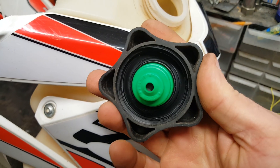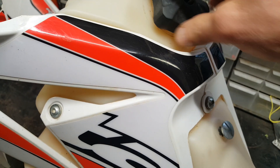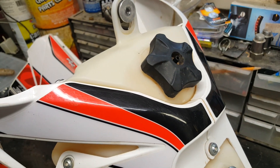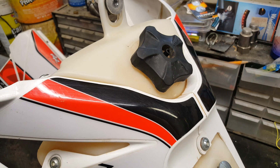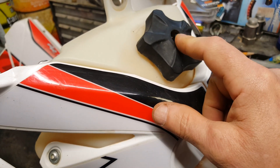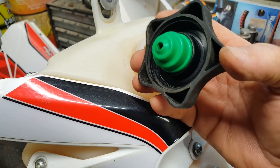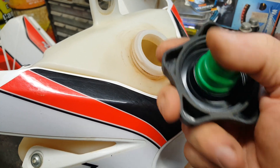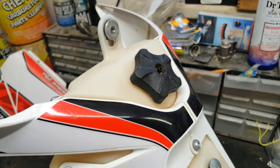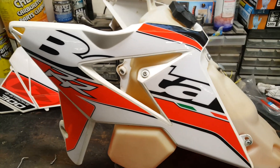But that's what it's for — it is a pressure relief valve. I keep mine in there so that if the bike sits for a week or so, and I don't keep fuel in there much more than two weeks anyway and I only use ethanol-free fuel — if a bike sits for a little bit, I'm not losing gas out my vent hole. So that's what it is. I hope this answers and clears up some questions. It's just kind of snugged in there, so if you do see it down in your tank, fish it out and put it in, or throw it in the garbage — it doesn't matter either way. Enjoy your Beta, and don't forget to subscribe.